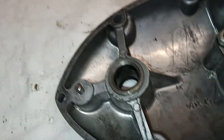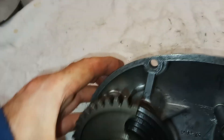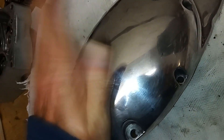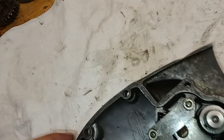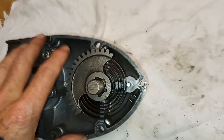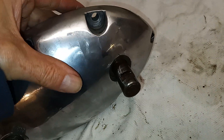Put a bit of lube in, and then we simply insert the kickstart shaft, which is good that it's slightly tight on the housing. I need to twist it carefully so I don't damage the oil seal — I'll just put the camera down and insert it through the oil seal. There we go, that's been pushed through. So that's the kickstart.